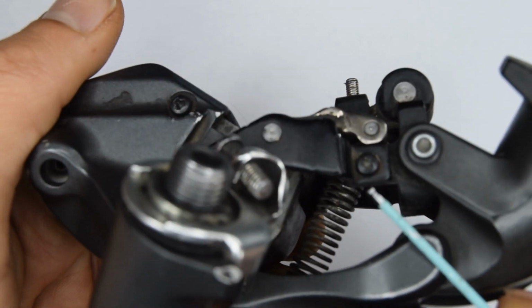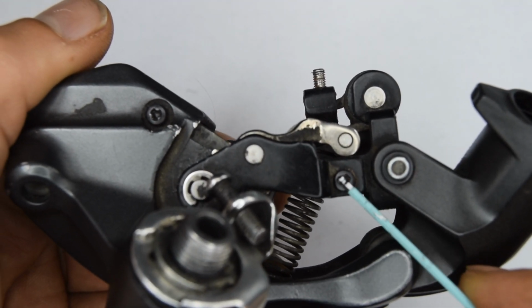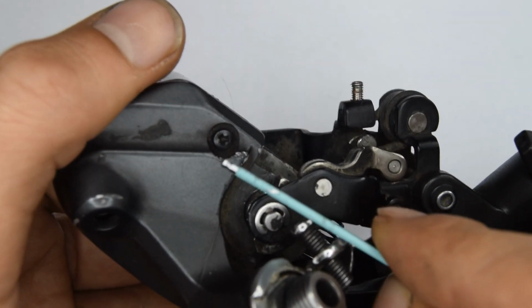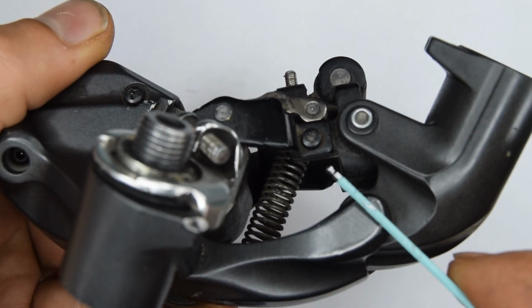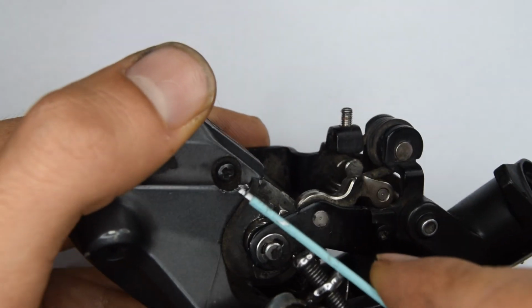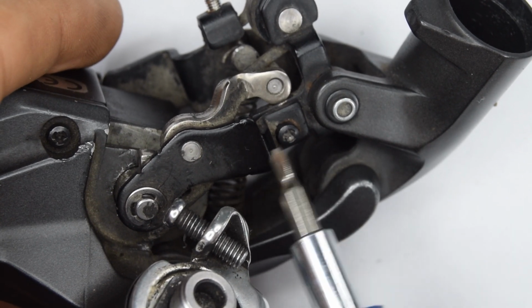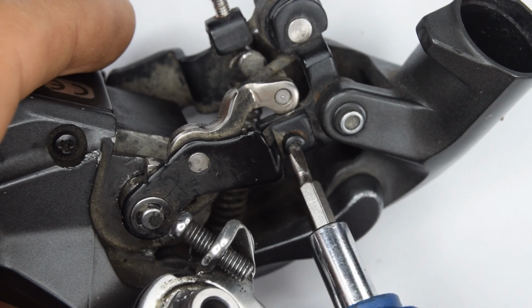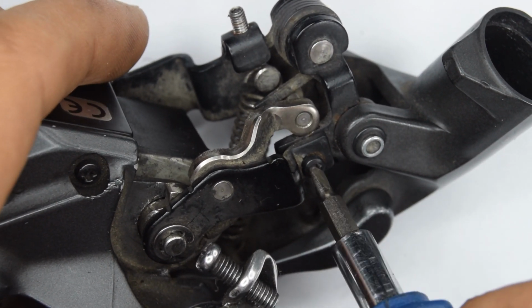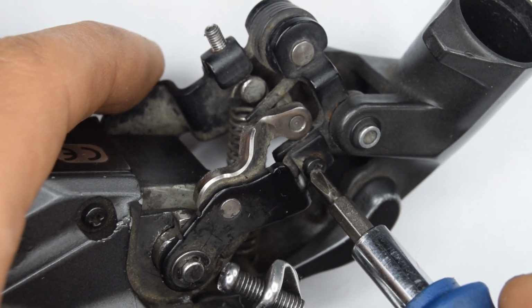And then here we're going to need to take off these screws. Now you'll notice that these are tri-wing screws, security screws. There's 1, 2, there's 3 of them. So we're going to remove this, and this one. Luckily for me, I had this security bit. You usually get them in those type of 100 set screw parts, and you never use them. But here it seems to be a good occasion.